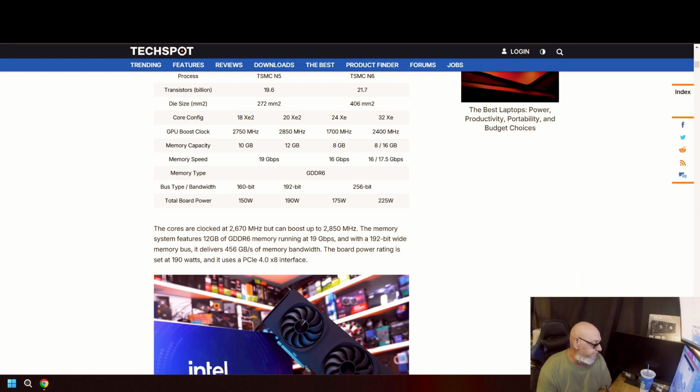Now, before we go on, I want to talk to you all a little bit about how PCIe works. You've got that top slot on your motherboard, that's an x16 slot. It depends on your motherboard. As an example, and don't forget your drinking snacks, by the way, the B450 will do PCIe 3.0. The B550 will do PCIe 4.0. The B650 will do PCIe 4.0 or 5.0. This is an AMD reference, so you understand that. Now, the B800 series will do PCIe 5.0, 4.0, and so on. Keep all that in mind.